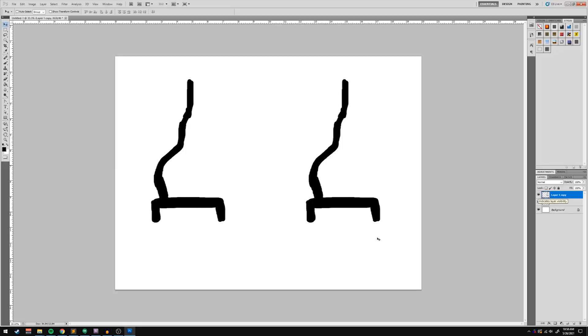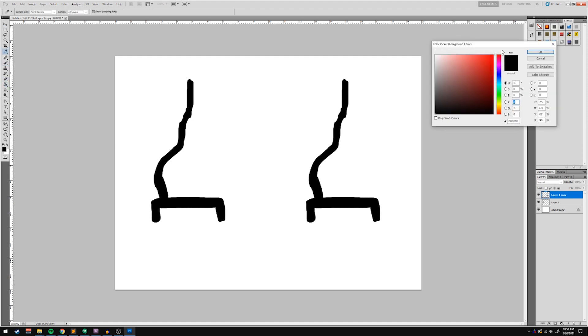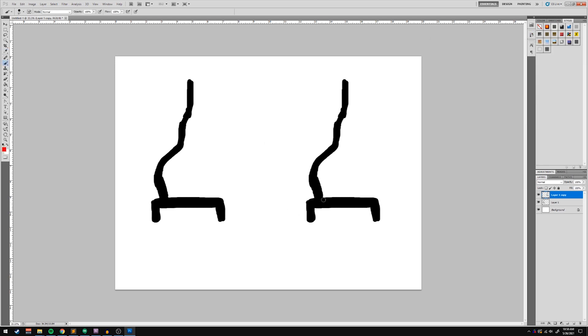The general idea for a drone pipe is adding a length of pipe perpendicular to the exhaust flow. There are two ways you can do that — I'll get to the length in a second — but overall what you want is as straight a pipe as possible and as perpendicular to the exhaust flow as possible. You can see a single exhaust all the way back to dual tips — that's what we're doing for this video. It doesn't matter if you have to clock it a little bit up or down, but as close to perpendicular as possible. That's going to be the best thing for you.